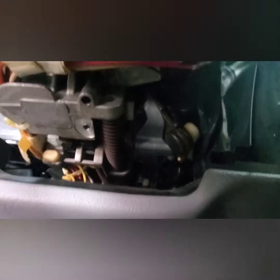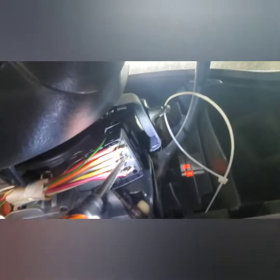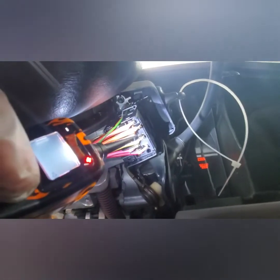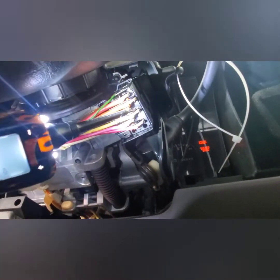between the ignition switch, which is here. It's between the ignition switch and that fuse. But this yellow wire, if I put power here to this yellow wire, based on my diagram, this should start the car too. It's not cranking. So there's probably a broken wire from the ignition switch all the way to the fuse box. So I gotta check the circuit on that.